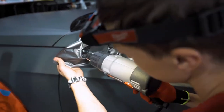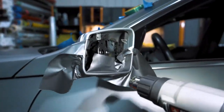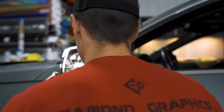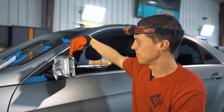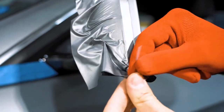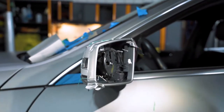And there we go — that's 80% done. That piece is pretty much wrapped. I'm just going to pull the knifeless, trim up the edges, and then do that two more times to these sections. For this section of the mirror there's kind of a big valley that you tuck the vinyl into. The idea behind here is I stuck knifeless on the outside of it, and I'm going to pull it and then tuck the remaining vinyl in. Then when I do the other side, I'm going to put knifeless on this side so it overlaps in this little divot area.